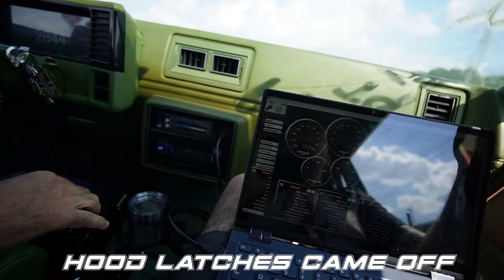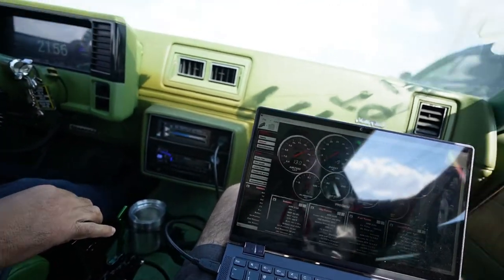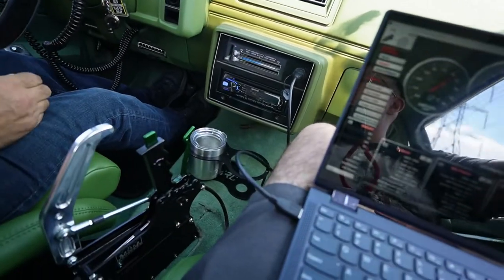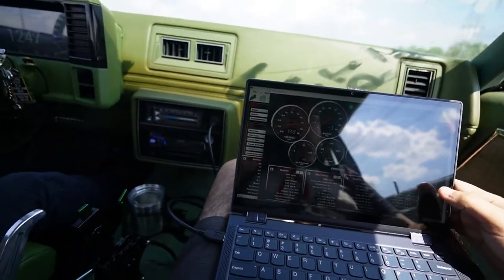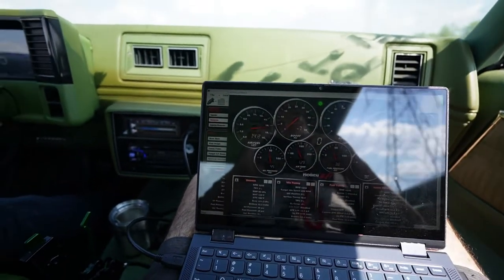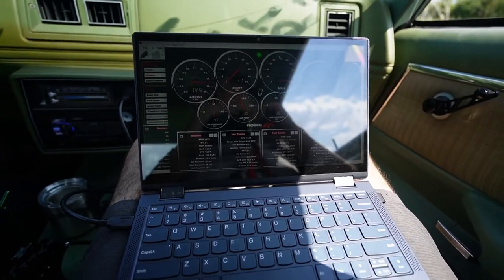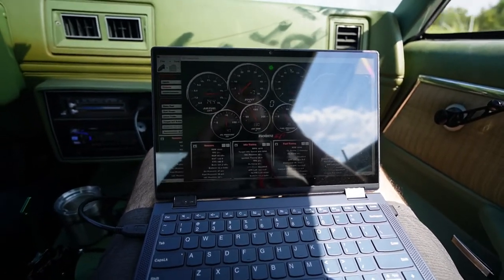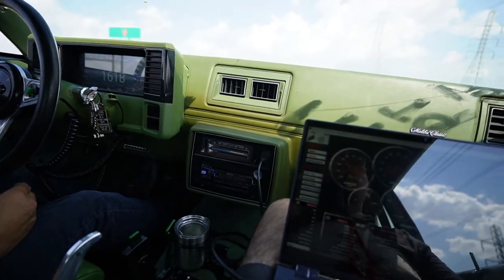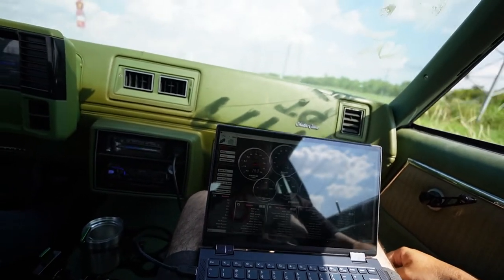The hood popped. Just go slower — if that hood goes up, we're fucked. It went all the way down. It made 10 pounds, so it's making boost. I noticed right away how much RPM the converter was dropping on the shift, but I just assumed that was due to it not having much power on only 10 psi. This may sound irrelevant right now, but it will make more sense in the next video.